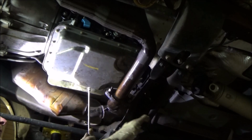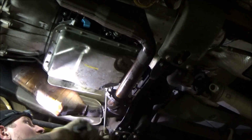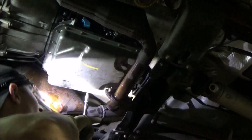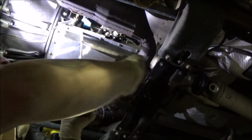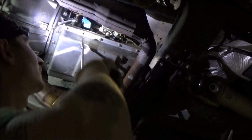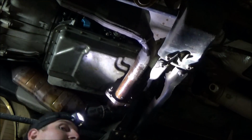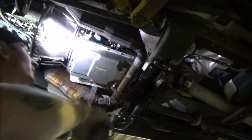So I'm gonna go ahead and torque all these down. Torque spec for these bolts is 89 inch-pounds. I'm just gonna work in a crisscross pattern. And some people don't torque these down. Like I said, I'm a little bit of a torque Nazi. But honestly, you would be fine just snugging these up. But in my mind, if you're going to do a job right, you should do it all the way right. So that's what we're going to do here.